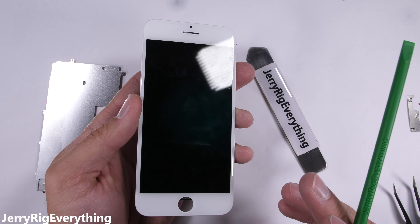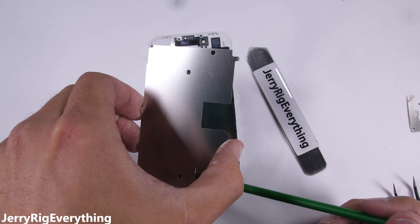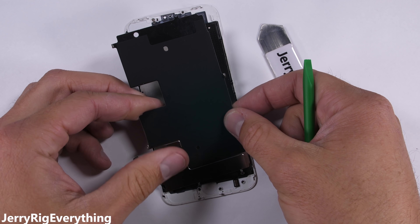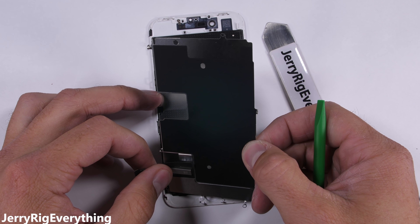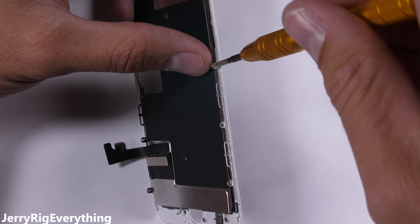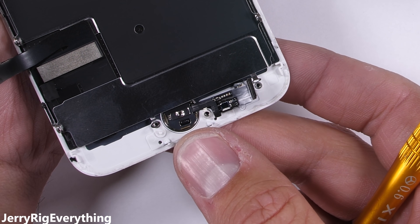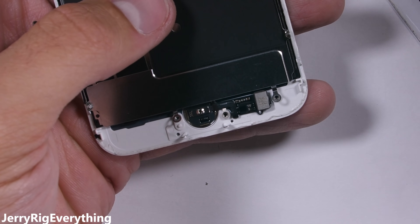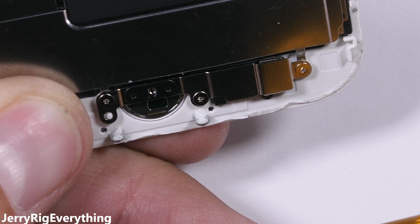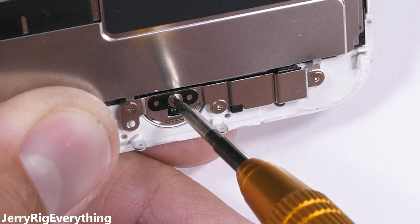This is probably what your replacement screen is going to look like — just make sure your new screen has everything that your old screen used to have on it. At this point you're either exhausted and stressed out from opening up your expensive phone, or maybe asleep from listening to me talk. As long as you kept your screws organized and haven't sneezed them off the table yet, the assembly process is pretty simple. Tuck the screen and home button ribbon cables back underneath that metal plate and screw it down with the three screws on the left side and three screws on the right side. Then grab the finicky home button and push it through the front side of the screen, aligning the ribbon up with the screw holes and the pin on the frame. The metal plate goes on top of the home button and the three screws around the edge are fine, but it's important not to torque down the center home button screw too far — don't even make it tight. It needs to be snug and firm, but screw it in too tight and the home button might not work anymore. So be careful.